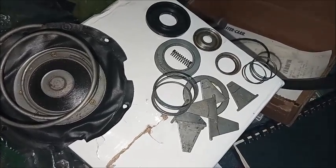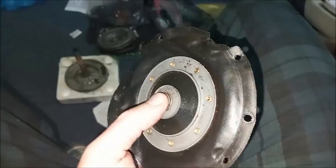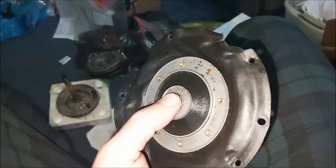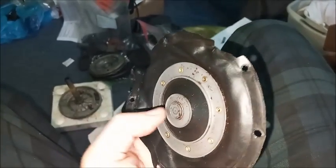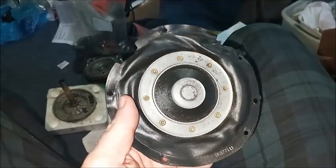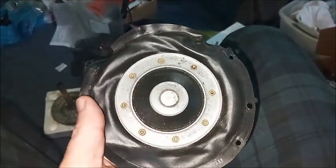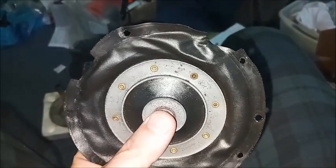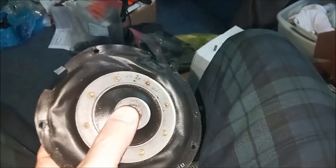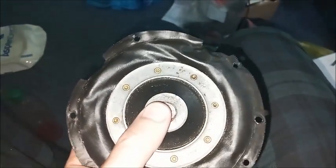So the Delco Moraine parts are on the right and the Bendix parts are on the left. This functions like the spring at the end of the air valve in the Delco Moraine. So it's pushing back. You apply the brakes and then you hold or release. This pushes back. The diaphragm, which is much, much bigger than the one on the Delco Moraine, also seals off the area where the airflow is occurring from the upper part of the inside of the piston.